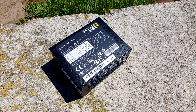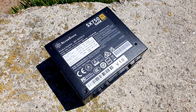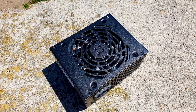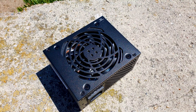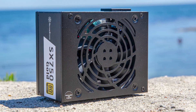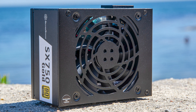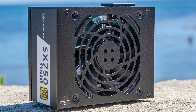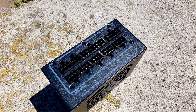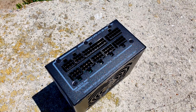Here is the SFX PSU unit rated for 750 watts, weighing around 1.5 kilos. On this side we have the 92mm hydrodynamic bearing fan, which unfortunately doesn't have a 0 RPM mode like the Corsair units — it's set at under 30% speed when the load is below 300 watts. The advertised 18 decibels of noise output will be tested later in the video. All of the ports for the modular cables are located on this side, and it's easy to determine which goes where thanks to the quick diagram imprinted there.